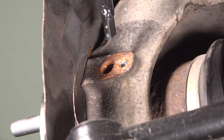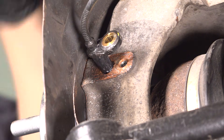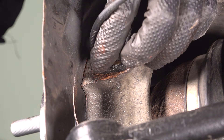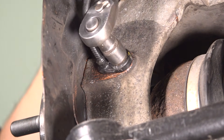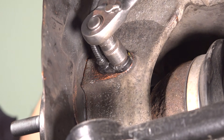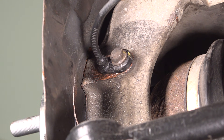Double check them if you want. I also put a little bit of grease on the half of the sensor that is closest to the wire, not on the tip. Slide that in and start in the mounting bolt. With it started, snug it up. This is a very small bolt, so once it bottoms out, about an eighth of a turn at most is plenty tight. Make sure it's fully seated and once it's tight, you're good to go.